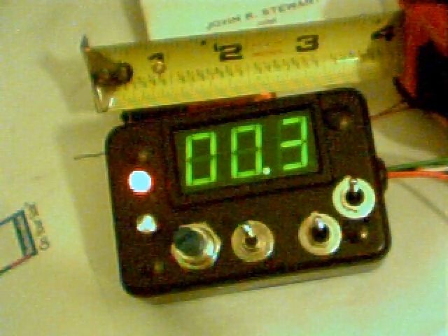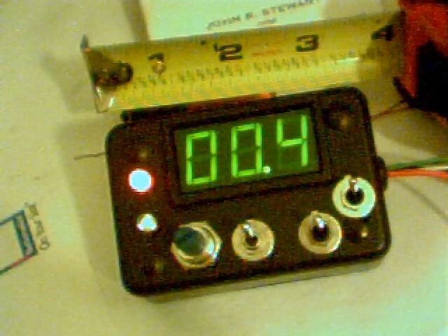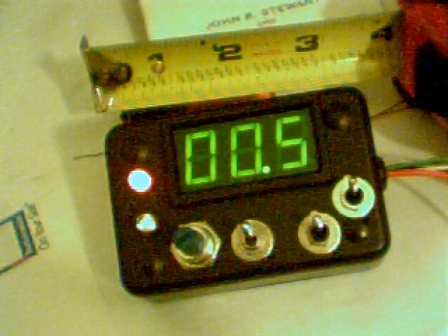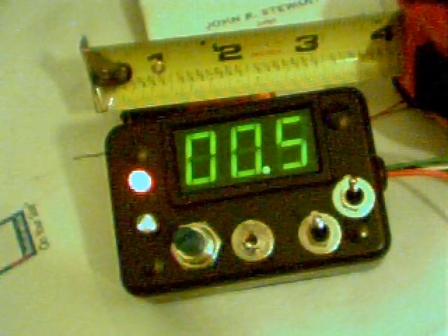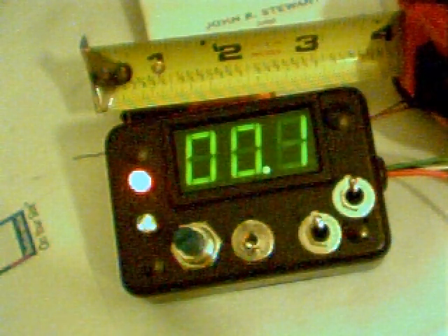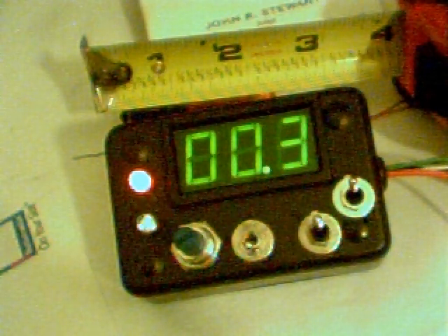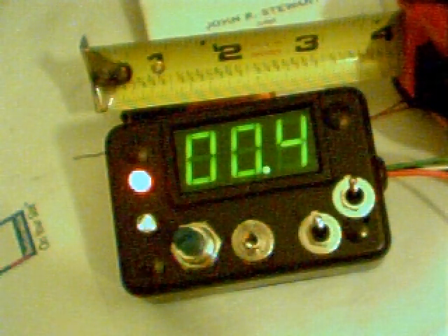This first switch is unlike anything I've seen so far. It switches back and forth between the simulator and your normal O2 sensors. This unit is set up for two pre-cat O2 sensors — six cylinder, eight cylinder, ten cylinder, whatever. With the switch up, the simulator connects to the ECM and the ECM only sees what the simulator is putting out. Clicking it down hooks your O2 sensors back in line with the ECM, removing the simulator — the car runs as if factory. If other sensors were throwing an engine code that the simulator was masking, you'd now pick those up.